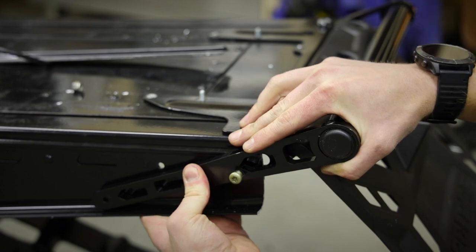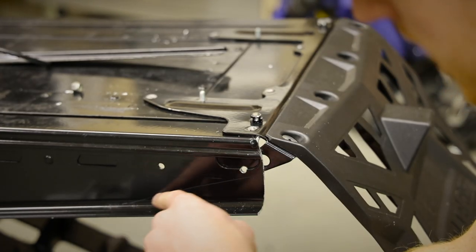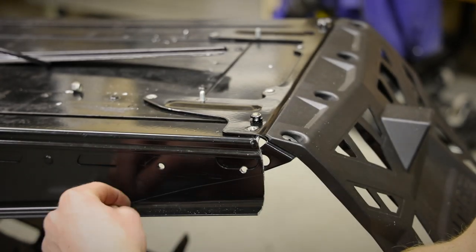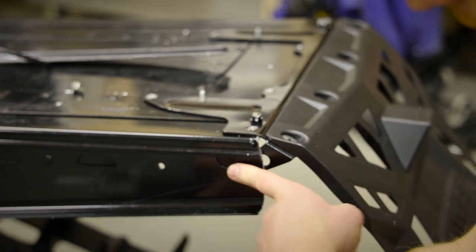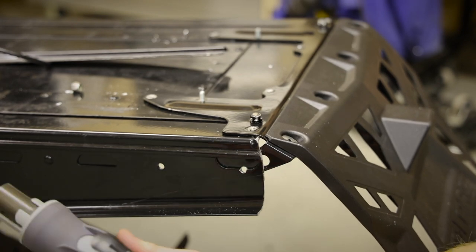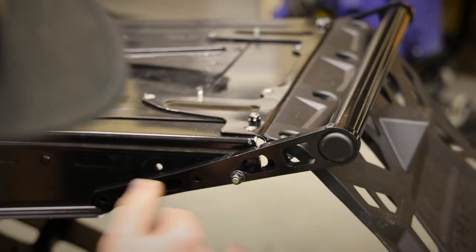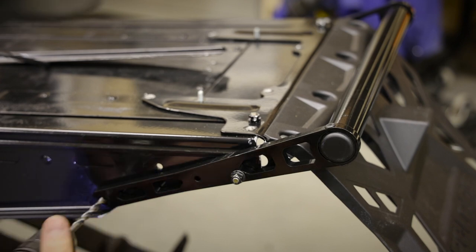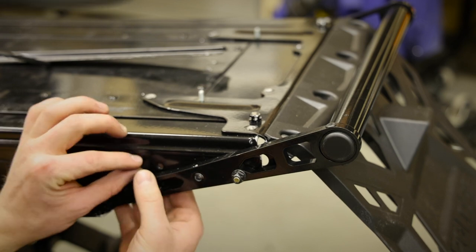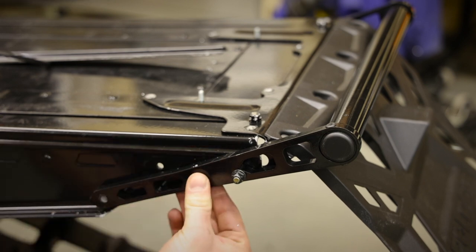I had the bumper mocked up, drilled some new holes, and scored a line of where the bumper is going to run down the tunnel. I'm going to trim this piece off here, make it nice, sand it out, and then finish mounting the bumper — drill a couple holes, rivet a couple spots, and be good to go. I'm going to use all the holes I can on the bumper. This bolt here actually catches a double piece of aluminum where the tunnel is folded, which is nice.